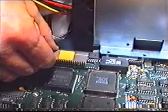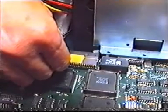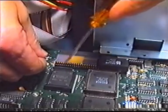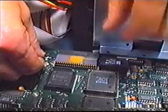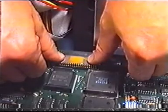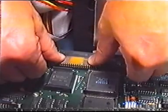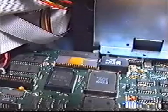You should pay careful attention that you align the chip correctly. Place the coprocessor on the socket, but don't push it into place yet. Check to see that it's aligned correctly and that the pins match the holes in the socket. Once you are sure the pins are aligned correctly and are positioned over each socket hole, press the coprocessor into place. You may find it necessary to rock the coprocessor back and forth slightly as you are pressing it in.